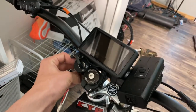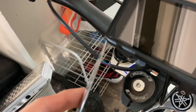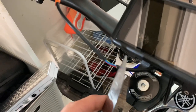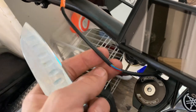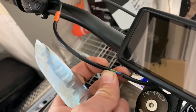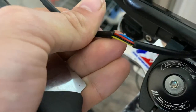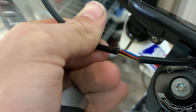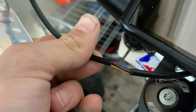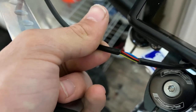It only took me about a minute to do this. I basically went around with a knife on both sides very carefully, then slowly went across and stripped the wire off. As you can see, we have a little section of this exposed. What we're looking for is this black wire right here. We're going to cut this black wire in half, strip it, and then solder it to the wires coming out of the ignition switch.